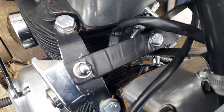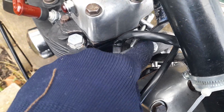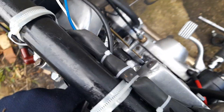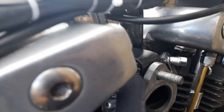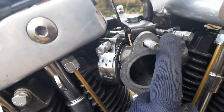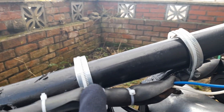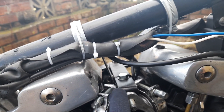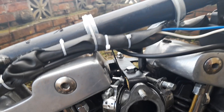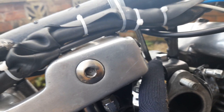So what I've got here is an L-shaped bracket that goes from where the ignition switch holds on through here. It's got a bend at the end — that's that bit there. I bent it and put another hole through it, and that bolts to this. Now that doesn't hold it up as such, so I've got this jubilee clip and this jubilee clip holding a bent bit of 3mm. It goes under that. It's very inelegant, but it does work. And then for extra rigidity, I put a bolt through the pair of them.